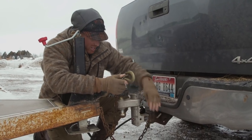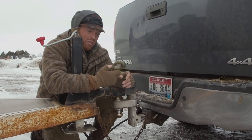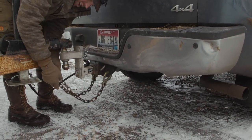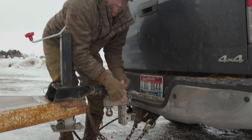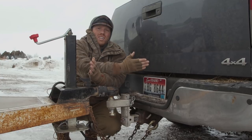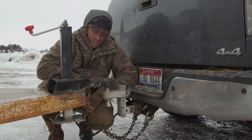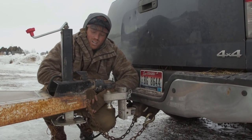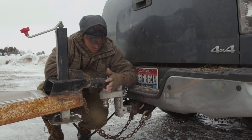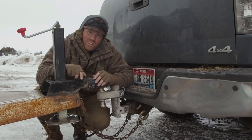This 2007 Tundra has a pretty thin hitch connection, but the 2011 Duramax we have is thick - having a big connector on the hitch end is really important. When you're connecting your trailers, always cross the chains. The reason is if the hitch somehow pops off or comes unlocked, having the chains crossed will catch the trailer. I've seen this firsthand - it happened to me once because I forgot to lock the trailer. Always cross those chains and always lock the trailer.